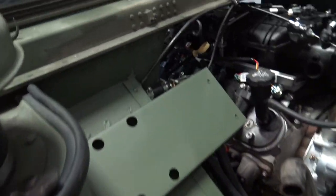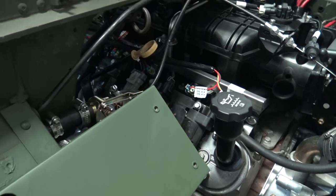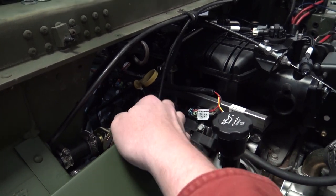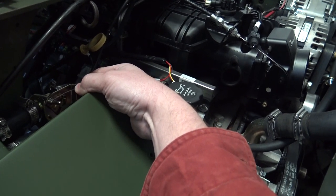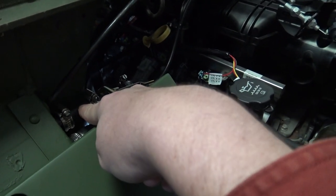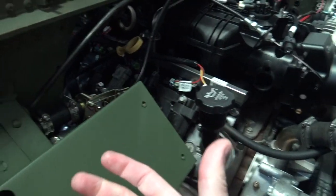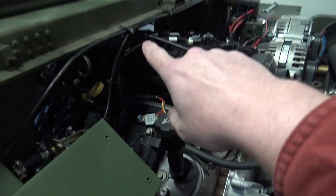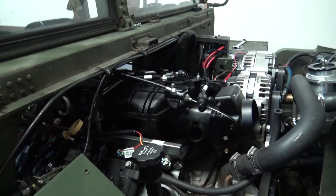I'm not going to put the computer on yet. The reason I had to wait was this heater valve back here — the one that was on there was plastic and kind of big and oversized. I wanted the original metal one, so I got it from Summit — it was like four to eight bucks, super cheap. I did all new hose clamps with those really nice clamps for the heater core because it was leaking a little bit before. To get to it now I'd have to take this whole thing off, which is a pain. Everything's hooked up — new stainless steel clamps along there.